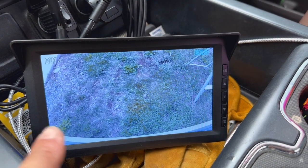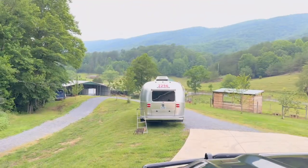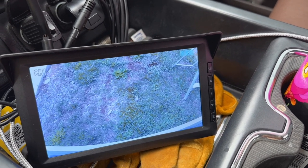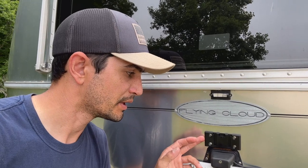You can see that I basically have it where you can just see the rear bumper right there in view. I tested it by putting that ladder on the side of the RV, and you can see where that ladder is back there — something I'd likely see in my rear view mirror. It's a very wide angle; I can see all the way to the edge. It came with four self-tapping screws, and that's what I used. I'm also going to grab a little bit of silicone and put a very nice, thin, clean bead around it, and back out each screw to run it in with a little silicone as well. Last thing is this little security Allen screw with the Allen key that goes right in here at the top, which will prevent anyone from just being able to lift the camera up off the mount.